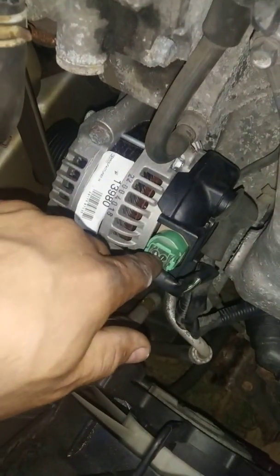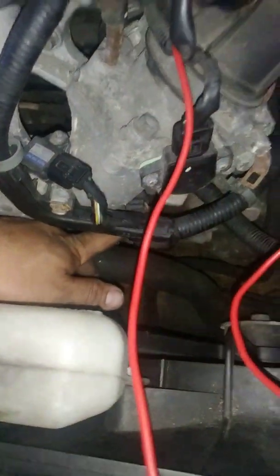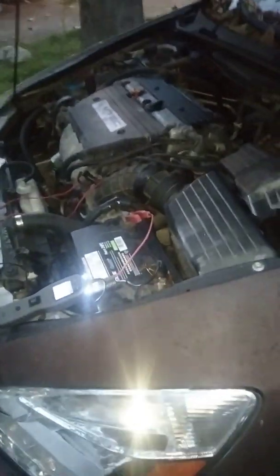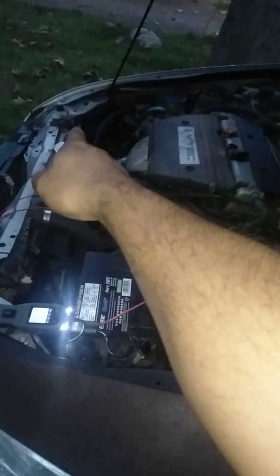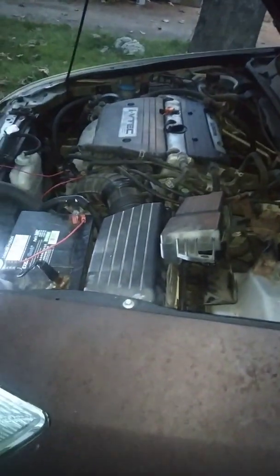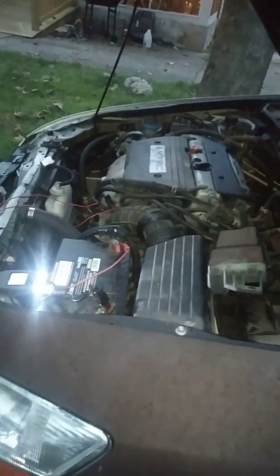What you want to do is check if you have 12 volts there. If you have 12 volts here or you have a ground, then it's probably a short right in this connector. If not, you would have to trace it at this joint right here. There are numbers on the back of this connector. From there you'll find where your ground wire is joined — one lead goes to the load detector and the other goes to the alternator.